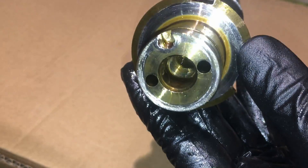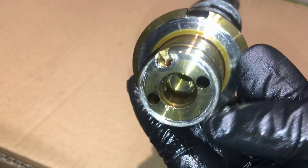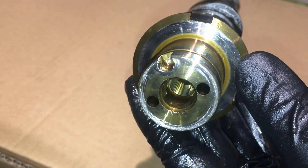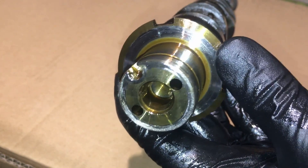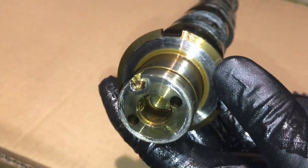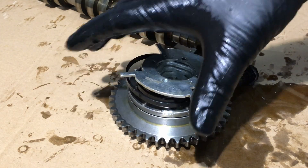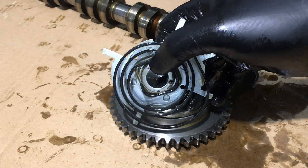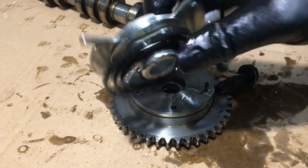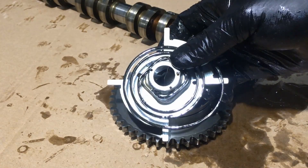That all makes sense — that's one heck of a noise. It was right there at the top by the phaser, knocking around, and there's metal transfer going on. I was actually moving it around to check for looseness and the thing flew off my hand, which was bound to happen because these three locating pins — these retainer pins — their heads were sheared off on this side from that bolt being loose and it moving around like that. So it was bound to happen sooner or later.